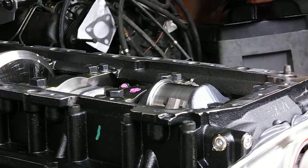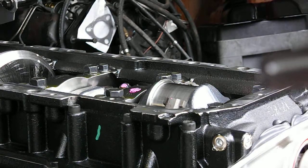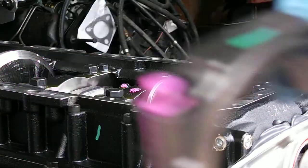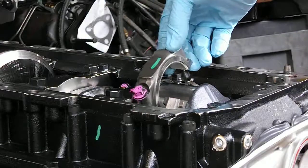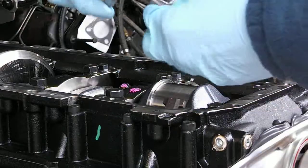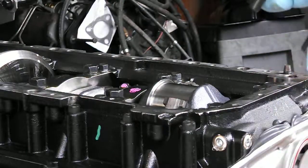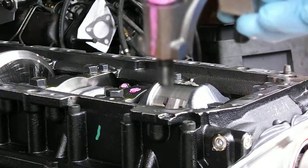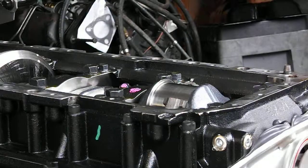The other thing too is when you take this off, you have to make absolutely sure that the cap goes on in the exact same orientation as it came off. If it came off this way and you put it on that way, you're going to have problems because the surfaces don't match anymore. So don't get them mixed up — get them marked and make sure you orient them in the correct direction.